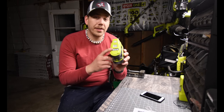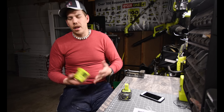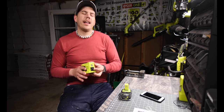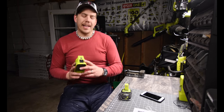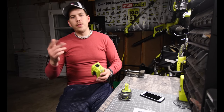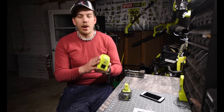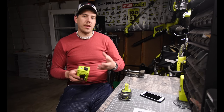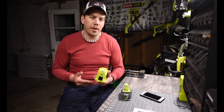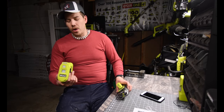Make sure you turn this off if you're not using it — this investment needs to be maintained. When it comes to the USB ports and the plug-in, make sure you don't plug anything in that draws more than 150 watts. Even if you use a hairdryer for a minute — I have not done that test because I don't want to risk the unit — if you exceed the maximum wattage, you could ruin this device very fast.